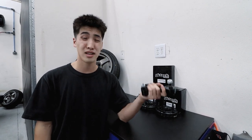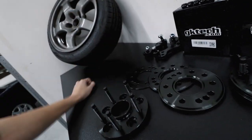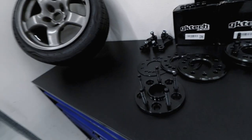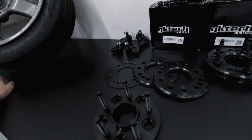Here comes the fun stuff. I have everything laid out right here and I'm gonna go brand by brand and tell you why I chose what I chose. I'm not affiliated or sponsored by any of these brands. First up is GK Tech — I'm running two products from them. Starting with their spacers: what's cool is they are hub-centric throughout all the adjustable pieces. Since I'm running these R32 wheels, having adjustable spacers gives me peace of mind so if a bigger spacer doesn't fit, I can take one out and push the wheel in safely without hitting a quarter panel or fender.